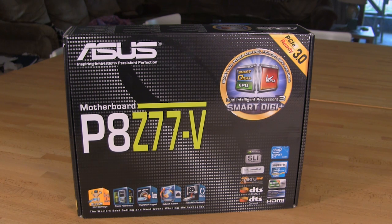You have your easy BIOS flashback. This uses a USB stick — you don't need memory, you don't need a CPU. All you need is power and a properly formatted USB key and you can flash this BIOS. This is great if you happen to get the board and for whatever reason, when you buy it in the store, it doesn't have a BIOS compatible with your RAM. You can grab that BIOS using another system and you're off and running.